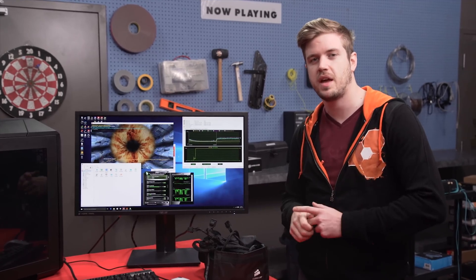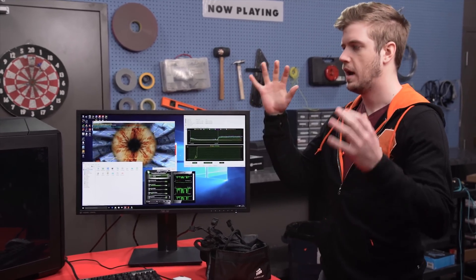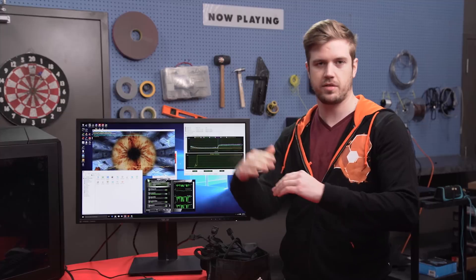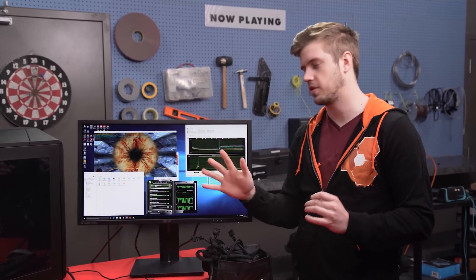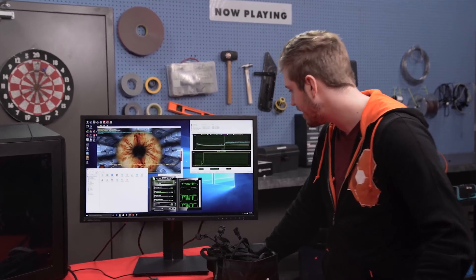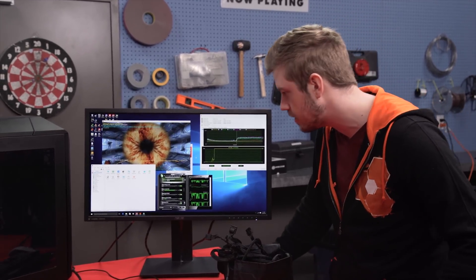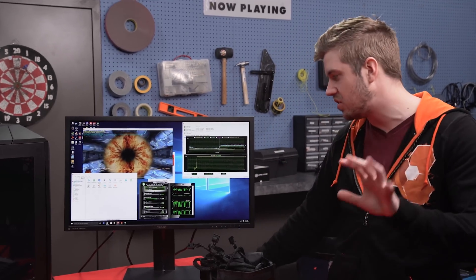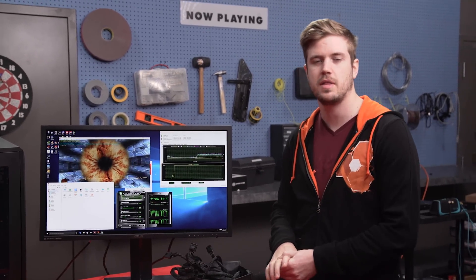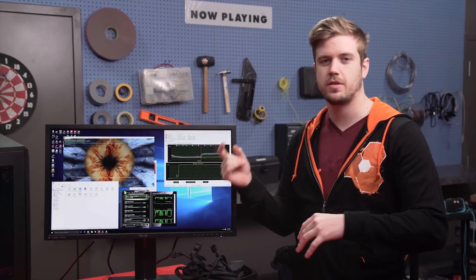Results of the first test are in — again this is just a benchmark for the rest of the benchmarks, where there are no real cable obstructions going on. Our CPU is at about 50 degrees and our GPU is at about 82 degrees. We're going to document that, make the cables a little bit worse, and move on.